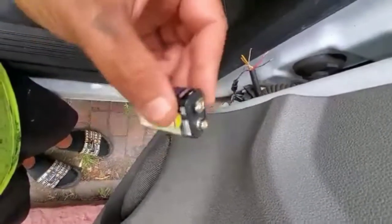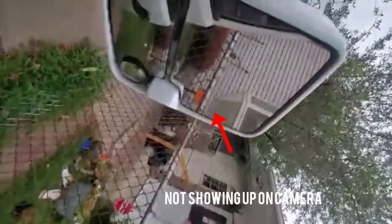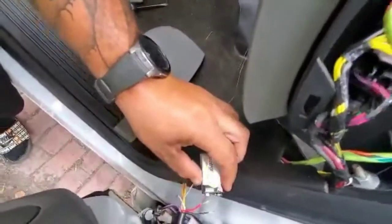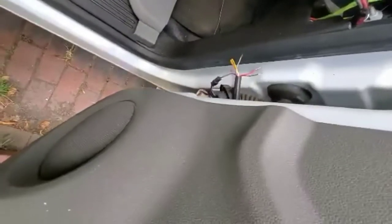This is where the 9-volt battery comes in handy — it's got a plus and a minus. Can you see that? See the blinker on the mirror — it's on, now it's off, now it's on. I'm doing it one-handed. That's what this little guy's for — you touch the wires and test them. That's how I found out that these wires are for the blinker. Those two wires are for the glass blinker and for the smoked lens on the front blinker. I got it written down here and I'll just keep going till I find out exactly what's what.